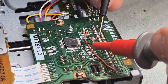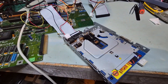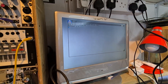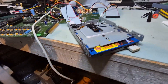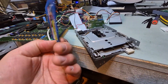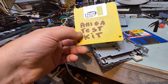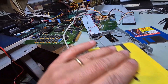It's going here - great. Right, we've got the drive in and I'm just going to put a floppy in and power the Amiga. The friendly sound - and there you go, hopefully. It's reading from the floppy. However, I want to draw your attention to one thing: this is a non-HD floppy - it has that little notch which is filled.